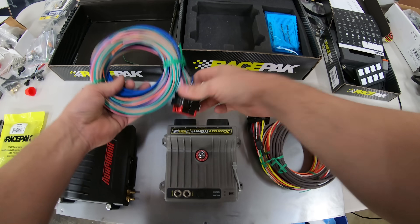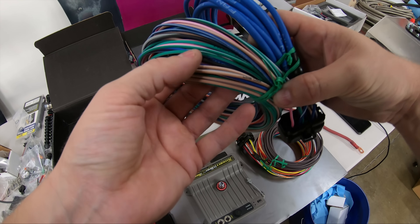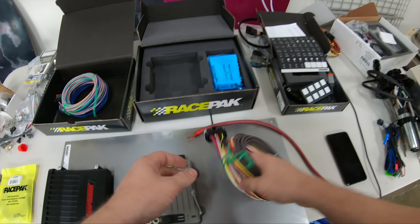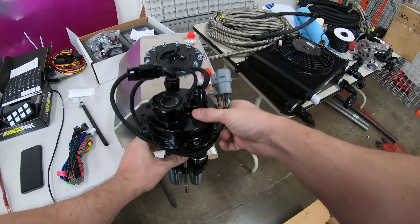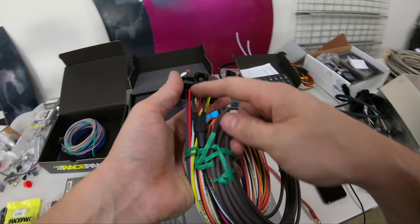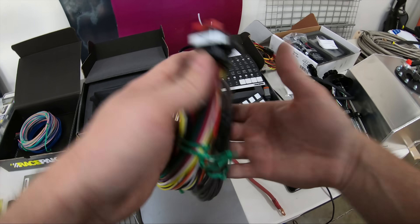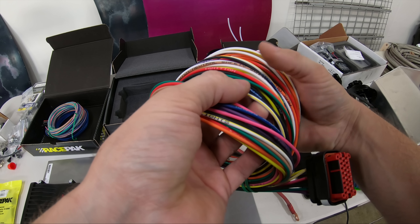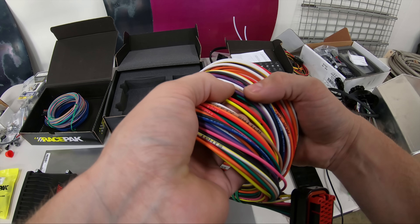These plug into the back right there. I'm going to kind of segment things away — I'm not going to pin them this time, just keep them coiled up and away. Most of these are not needed at the moment. This is not a car, this is an engine stand. We'll probably have some sort of manual switch to shut everything off. Clearly we'll have the fuel pumps, which will also be on the ground. This unit has multiple 20-amp circuits and tons of 10-amp circuits — fuel system is going to take 40 amps. 38 amps peak, two of these, and we can watch that in the PDM. Brake lights, ignition, starter. Brake pedal switch, clutch neutral safety switch — a lot of these are inputs.